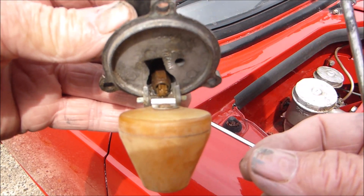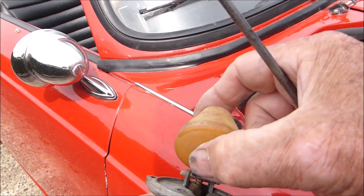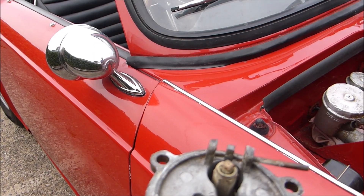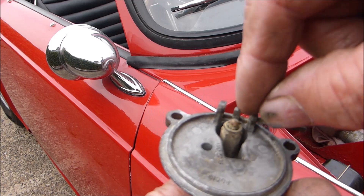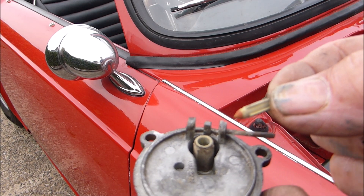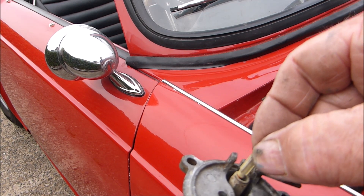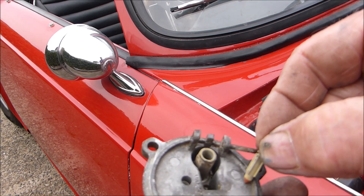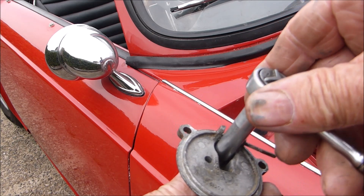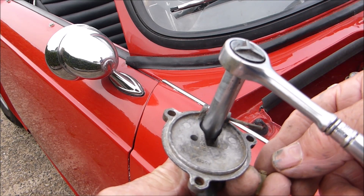I'm going to change this anyway. What I've got to do now is take this pin out to allow me to take the float off so I can get access to this — there it is. You can see I just lift that out; you can't get it out without taking the pin out. The point there looks fine — it's a little neoprene tip — there's nothing wrong with that, it's probably perfectly all right, but I'll change it anyway.